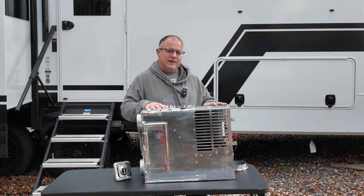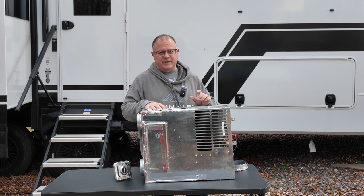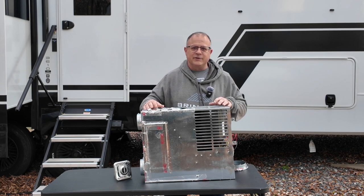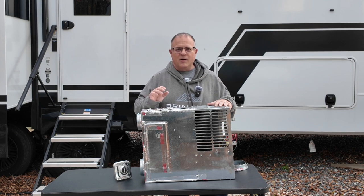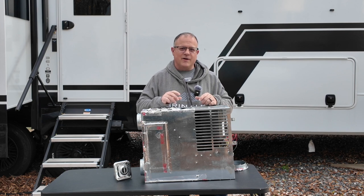If not that, and you're getting propane, then it may be that ignition spacing and gapping. It can get dirt in there too. A little piece of lint or something could keep it from making a spark, or the gap could just have gotten too wide. So literally you can pull that out, put your 1/8 drill bit in there, see if it fits right, clean it off, and push it.